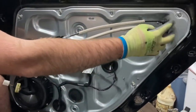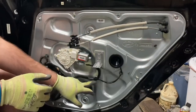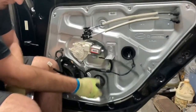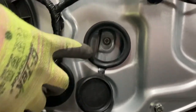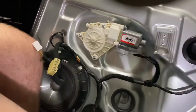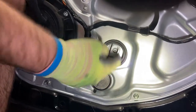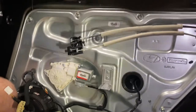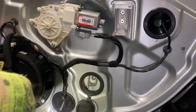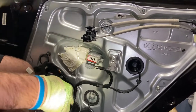You just have to get these rubbers back through the whole assembly, pop these in, and then get the rubber through, and plug all these connectors up. Here's the access panel to get to the screw that releases the window from the window regulator, which you have to take off to get the whole window regulator out. When you put it back on, it's a little bit easier. Our problem was the cable was broke, so when we took it off it was better to have two people to hold the window because it just wanted to fall down. When you get the window off, make sure you don't break the glass.